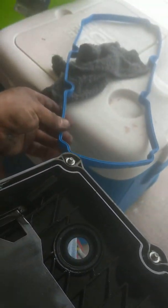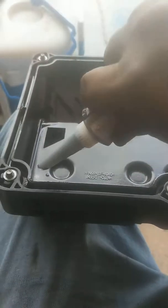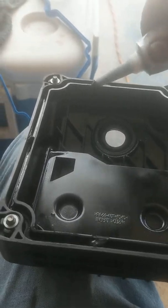The other problem you're going to have is when you put the actual seal in, it has a tendency of popping back down and falling out. So what I'm doing is just taking a little bit of black silicone and putting it inside of the track — just a little bit, not enough to really affect the gasket in any way, definitely not trying to create a seal.